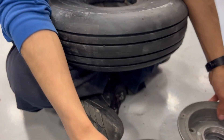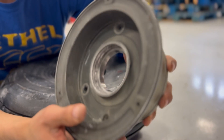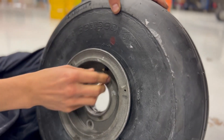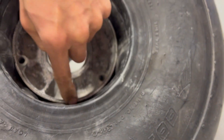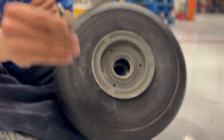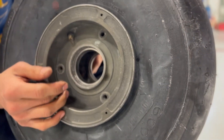It turns out we had to clean out these old wheel halves and find the best bearing races we could. It's not airworthy, but it's a training plane, so we're just gonna get this thing put back on the ground. Tyler took the wheel off, so I'll do my part. This is our balancing mark — comes like that from the factory. The scary part is you might get this inner tube pinched. It's been a couple years since I've pinched one. Typically you'll want the bolt heads opposite the stem. The idea is when the pilot checks for the cap here, you can also see the nuts are still there holding the tire together.